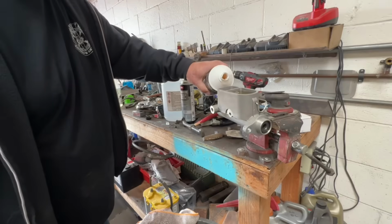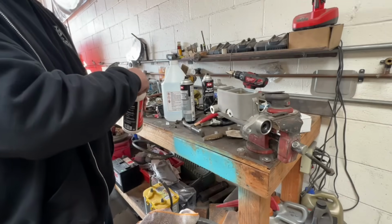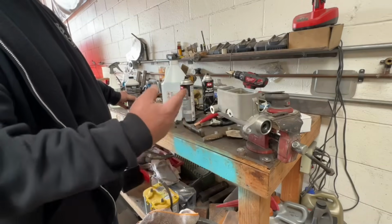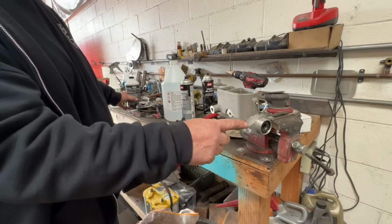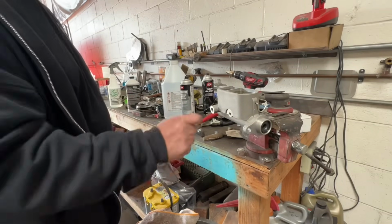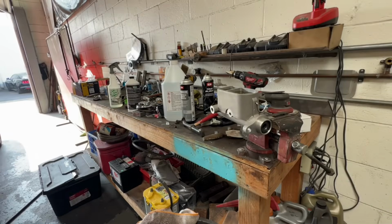Also, when the master cylinder is being pushed manually by your hand and maybe a screwdriver, it will go full throw. If you were to put this in your car and try to bench bleed it, there's a good chance that the pedal stops before the piston in the master travels the full distance, at which point you will end up with always a spongy pedal because there will be a gap of air inside there, a pocket of air. Hold please.